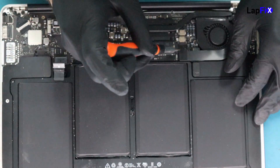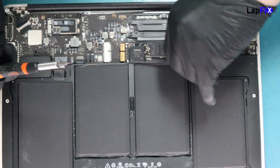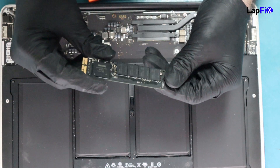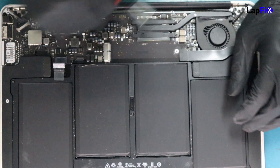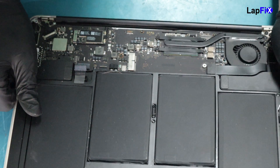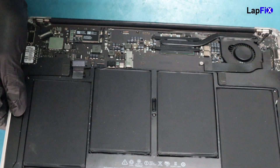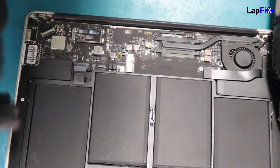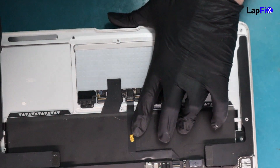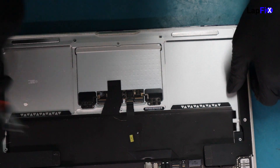Let's take out the SSD too. Hopefully there's nothing really damaged — we can test the SSD to make sure there's no problem, but mostly it looks to be pretty healthy here. We always like to give the customer options to make sure there's no other damage to the SSD. We always want to see if there's a problem with the board; if they don't want to fix the board we can at least give them options to recover data. We can also see this has been replaced before because there is a sticker here — Apple doesn't usually have a sticker, so we do know there is a replacement part here.